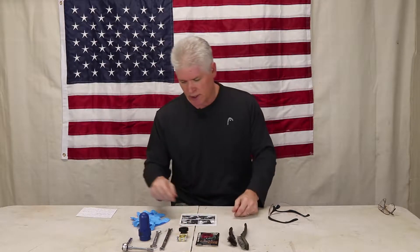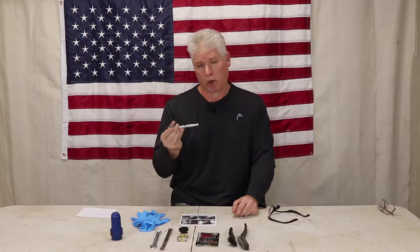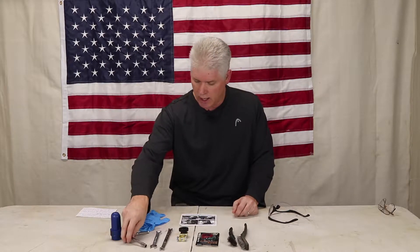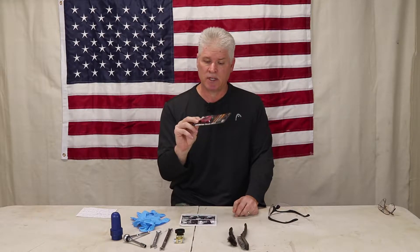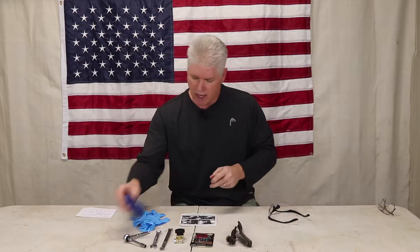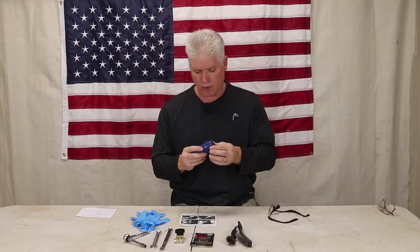The second thing you're going to need is whatever size tool fits your battery terminal. We're working off the negative battery terminal, so in my case it's a 10 millimeter, and I'm also going to be using a half inch for the new connector. You're also going to need a set of battery terminal protectors — the red and green ones. And a couple of different types of wire brushes, or even better, a battery terminal cleaner made specifically for cleaning terminals.